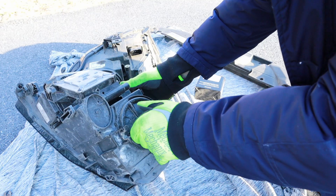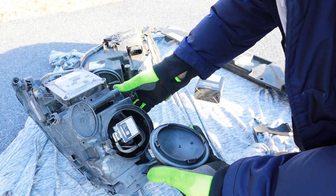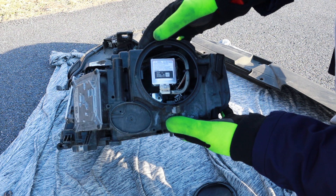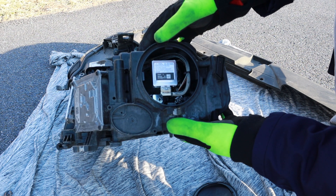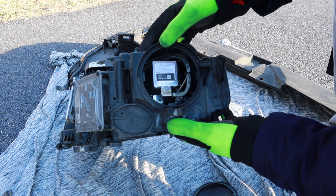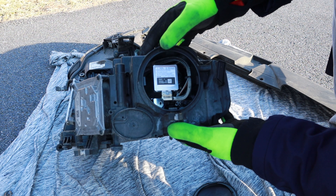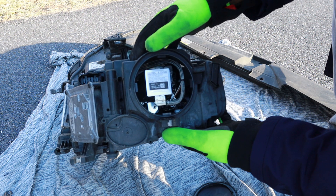I'm going to go to where the housing's at, right down here, and give it a quick turn. The ones that came with the car are the Philips D3S, which are supposed to be top quality — I think they have something like 10,000 hours. The price of one of these was even more than the price of the two I got. It was also like a 5500K compared to an 8000K. We're going to see how these 8000K work. If they're garbage, I'll just go with the Philips, but I wanted to try them out at least.